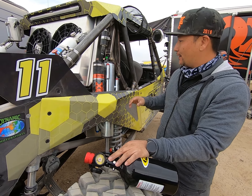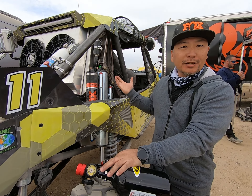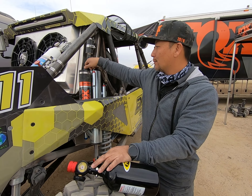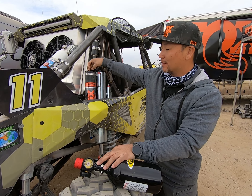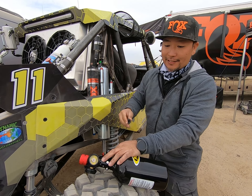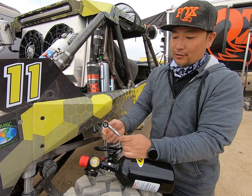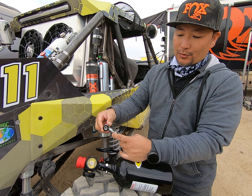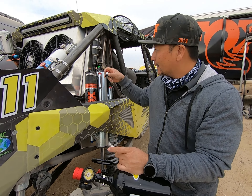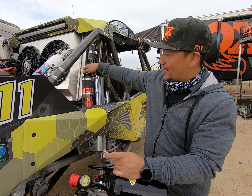What we have here is one of our 4.0 bypass shocks — it's pretty much the same on any shock. You're going to have a reservoir, whether it's mounted piggyback or on a hose, and you'll have one end with a cap and a Schrader valve. One of the nicest things about the shock filler kit from Power Tank is that the zero-loss shock fitting is a quick disconnect, so you don't have to fumble around trying to thread it in.